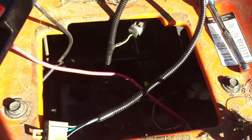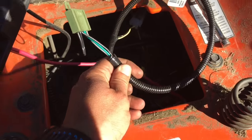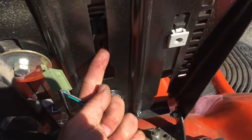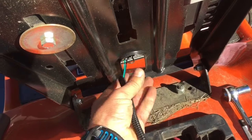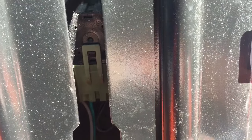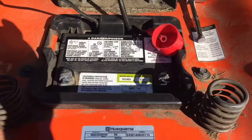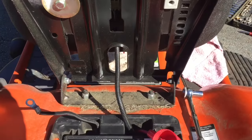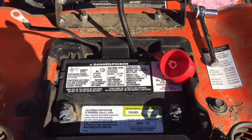I've taken the black plastic that the battery sits in completely out so that the whole thing fits. This piece right here goes through the battery compartment and plugs up underneath the seat — that's your seat sensor. You've got to get that in or else your mower won't start. Thread that seat sensor through where the positive on the battery is; it comes up under here and just plugs in up top. Getting that sensor plugged in is a little tricky — you don't have a lot of room — but basically get your finger underneath and push it up until it clicks in place. Once that clicks in, your sensor is good to go. Now you can see the battery compartment and battery back in, with that seat sensor coming down through the positive hole and down where the rest of the wiring goes.